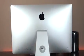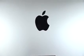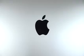So along the back toward the top, you'll find your Apple logo. That's part of the Wi-Fi system, so Wi-Fi needs radio transparency to work through the metal body, and the black plastic Apple logo is there for that. And just above that, we'll find a set of dual microphones etched into the metal. You'll find one facing toward the top along the edge of the iMac, and another one facing the rear.